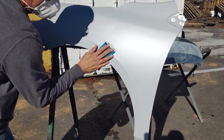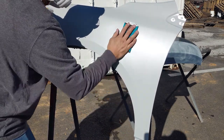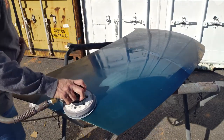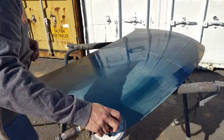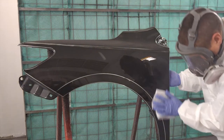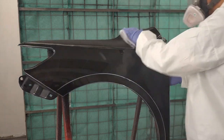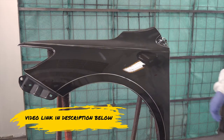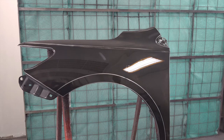Before you start mixing and painting, make sure your parts have been sanded and cleaned properly in conditions good for painting. To properly prepare your parts for paint, use Urochem's SVWG wax and grease remover, then dry sand with P600 grit and clean again with SVWG. SVWG should be wiped on wet, then wiped dry with a separate lint-free cloth. For more details on the proper use of our surface cleaners, refer to our video or tech sheet on our website or here on Urochem TV.